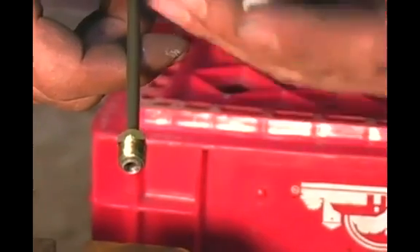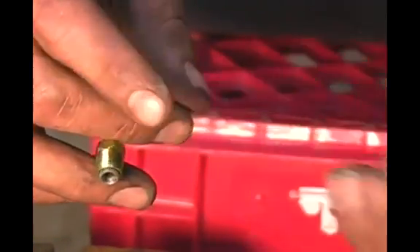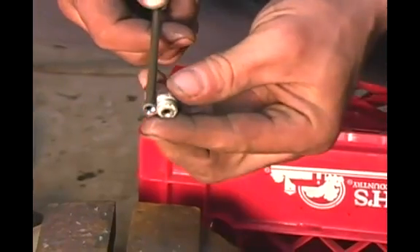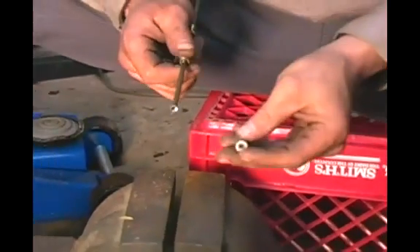What I'm going to do is reuse it. I'm going to take a drill and drill out what's left of the brake line inside there and pop it out. I'm going to take my line cutter and cut the line, slide that fitting on with the hex nut towards the inside, and then re-flare the line. That'll give me the right fitting on my new line.